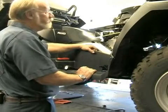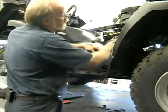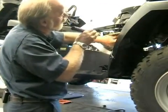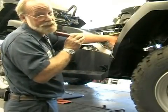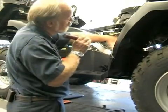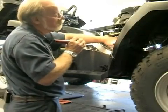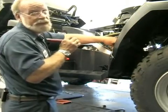Periodically they call for it every 100 hours — it's in the service manual. This valve cover up here has got a ring of bolts around it, I think there's nine. Underneath that there are three screw and lock nut adjusters: one for the exhaust and two for the intake. On Polaris quads, the motor has to be at top dead center on compression, and then the three adjusters have to be set at 6,000ths clearance. All Polaris's basically are 6,000ths clearance.